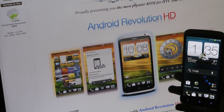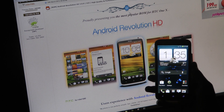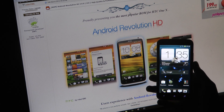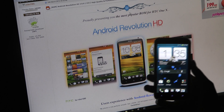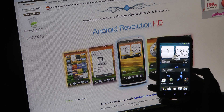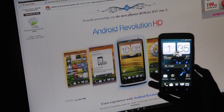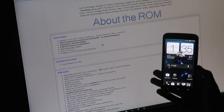So if your smartphone is up and running, that's awesome news. Now go ahead and turn the device off, go back into fastboot mode, and what you want to do now is flash the Clockwork Mod Touch recovery again. Just type in 'fastboot flash recovery' and then the Clockwork Mod Touch file name, the same way we did with the stock recovery. Now when you have Clockwork Mod Touch recovery installed, download the latest Android Revolution HD.